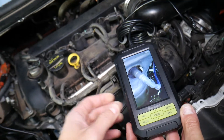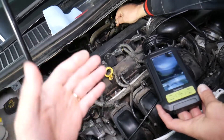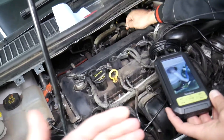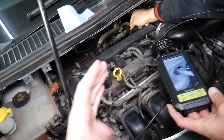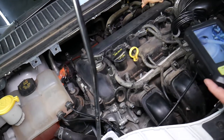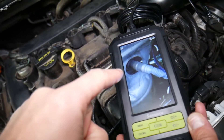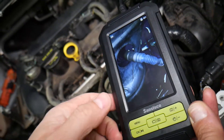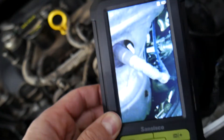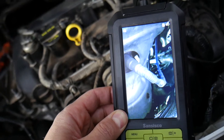The purpose of that upstream sensor is to detect how much fuel and air you still have in the exhaust system, so it can send that information to the engine computer. The engine computer can then figure out whether to add more fuel or adjust the air mixture for a clean, efficient burn. An oxygen sensor not reading correctly is very likely why you get that P0171 code.